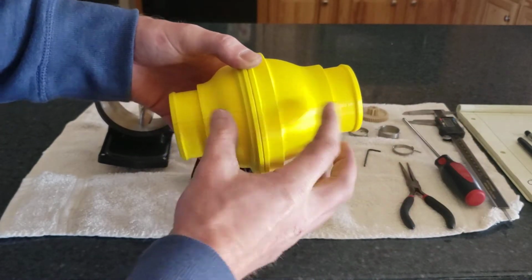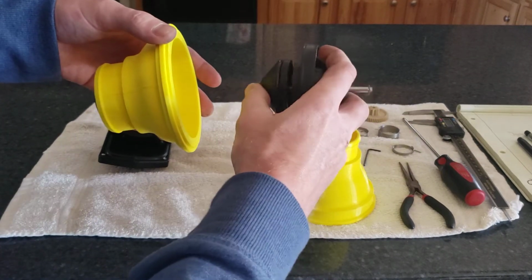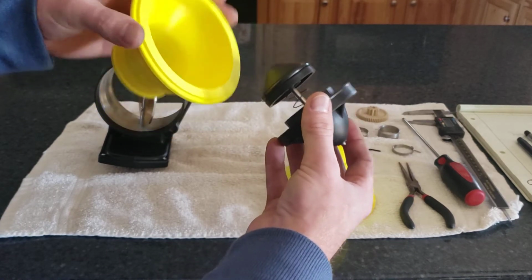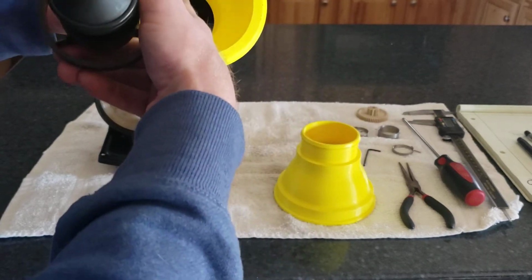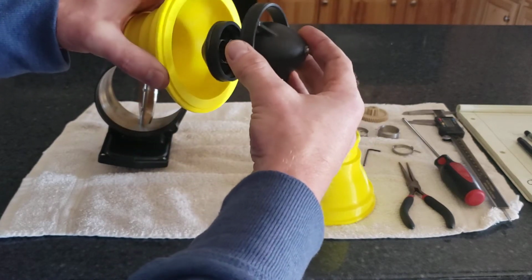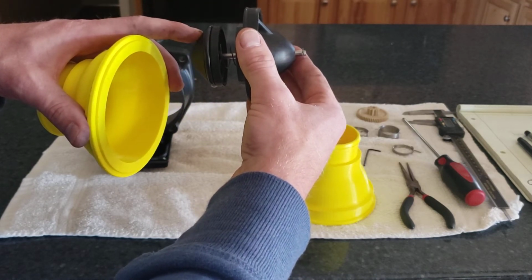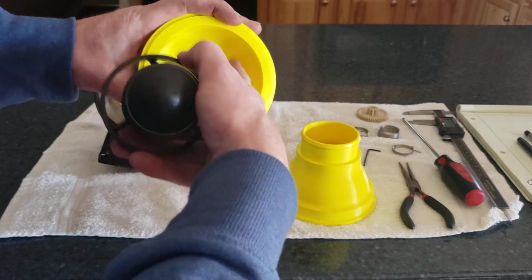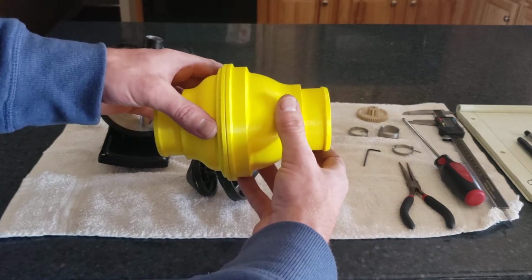in this direction to bypass going through the eBoosters. And so this passive spring-loaded valve would sit inside the housing. This particular valve is actually a bit small, and this housing is designed for a larger version of this. But this O-ring seal would seal against the inside of this housing. And when the valve is inserted, mounted, that valve is just slightly compressed. So it's always passively maintaining an active seal against the housing with this O-ring. So then this other half would come and kind of sandwich the two.